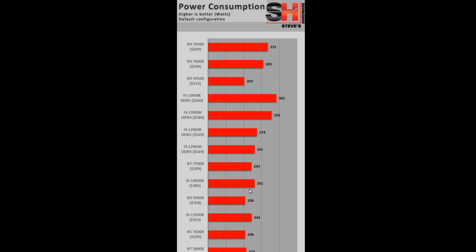Now here's the thing about transistors used at high speeds. The voltage frequency curve does not scale linearly. It is literally an exponential curve. So the higher you hit your frequency boundaries, which in this case this thing is probably aiming for 5.8 at default, and most users are going to aim for 6, but they're probably not going to hit it. Or they might hit it with one core. Basically, I'm talking like air cooling or water cooling. It's going to be pretty hard to hit 6, but you can do one core. We almost tuned it out.